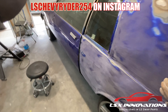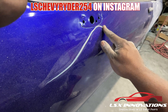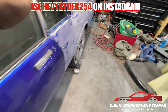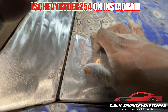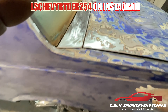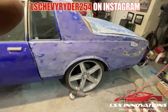The issues that were concerning were these stripings over here — I honestly thought it was down to the metal, but it wasn't. There's just the silver that's up under there, and as you can see back here, there's a lot more protection on this car than I even knew. Let me do some more sanding and strip disking. On the sides I've just been 80-gritting it.